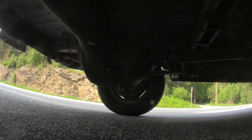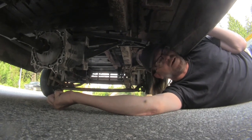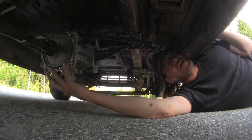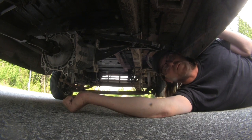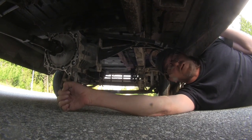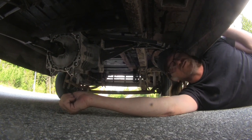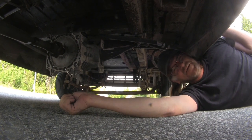Leaf motor straight to the driveshaft with a 7.4:1 gear ratio — it should do over 160 kilometers per hour, but I've only done 145 and that was scary enough with this old van. It goes as fast as it needs to and it'll spin its tires, so I'm really happy with the drivetrain. For a future episode I'll take you through a bit more of the electronics — the charger, the inverter, and the Resolve controller. Now I'm going to crawl out from underneath this van.